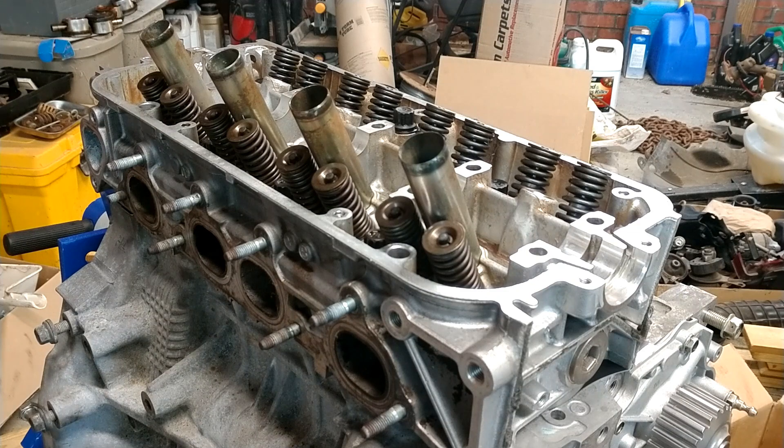That's going to be our stopping point right here. I figured just one video on getting the head installed correctly would be enough information to digest at once, and this can be a standalone video for anybody trying to put a cylinder head back on top of the F23. Remember: it's 22 plus 90 plus 90 plus 90 — three 90-degree turns after the 22, in that specific zigzag pattern. If this is your first visit to the channel, check out my other videos. If you see anything you think could have been done better or differently, please leave a comment below. Like the video if you think it's going to help you out. Thanks for the visit and I'll check you guys out in the next one.